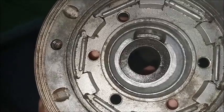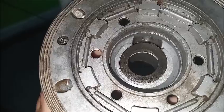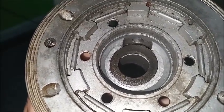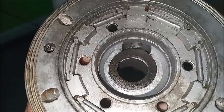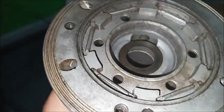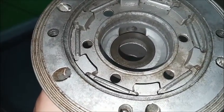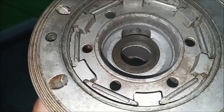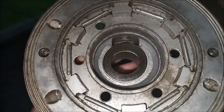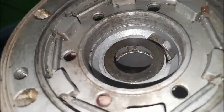This rubber ring, which sits on the bottom of the floating control valve, when it's sitting here, it's blocking the vacuum. When it gets lifted up from there by the air valve, that's when vacuum is allowed to reach those four ports. Normally, the air valve sits a little below this ring. When that's the case, air is allowed through to these four ports.